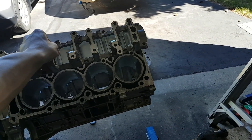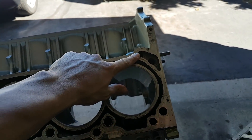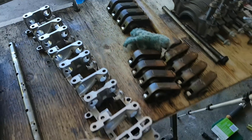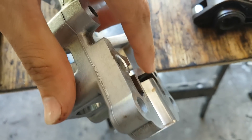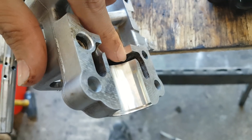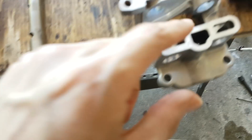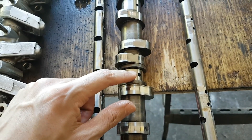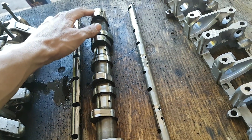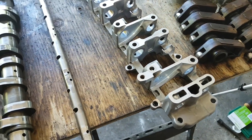Just to quickly explain how the oil flows in these heads: the bearing bridge sits on the engine, and there's an oil passage on the block that feeds oil pressure to the head. From the head, a drilled hole leads that oil pressure to a gallery. From there, oil goes to two places. First, it goes to the camshaft — there's a hole on the camshaft that sits right on that groove, so oil pressure is fed into the camshaft and flows out through holes in it. This is what lubricates your camshaft so it doesn't run dry and doesn't start scratching up the bearing bridge or the head.